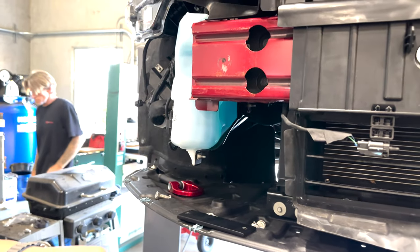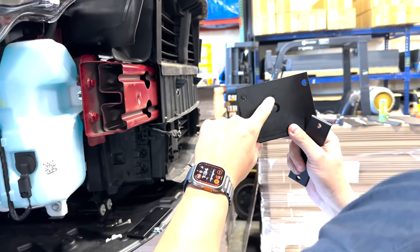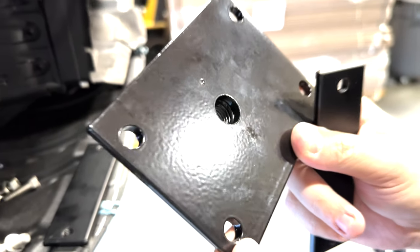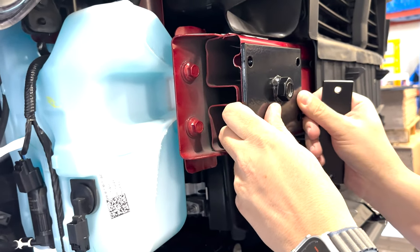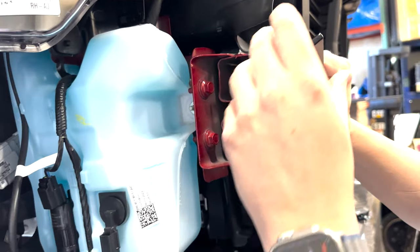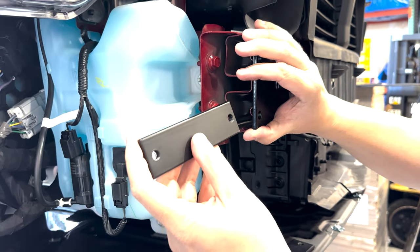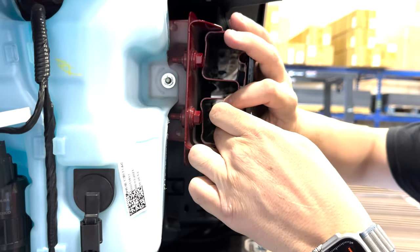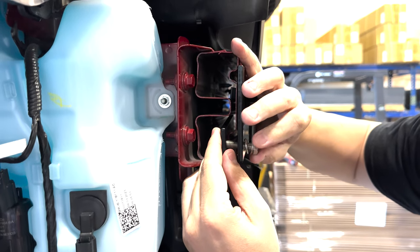The install is really simple. There are going to be two metal backplates that slide behind the crash bar. And if you look at the actual receiver right here, we put a little pin mark — a dimple — and that's going to tell you which side faces up. In this instance, dimples up, it's going to sit right here on the crash bar. These backplates are threaded, so we're going to be using stainless bolts with locking washers, and they're going to thread right on into these back pieces.